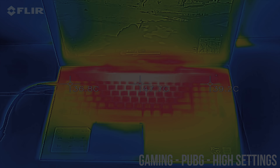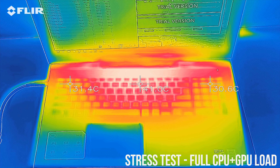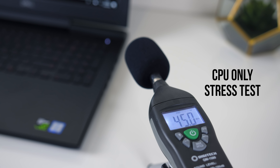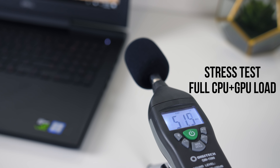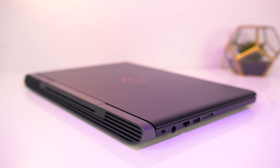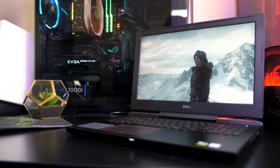While gaming the CPU clock speeds didn't change much with or without the undervolt — there was no thermal or power limit throttling taking place, so I'm not sure why the full 3.9GHz all core turbo speed wasn't the average. Under CPU-only stress tests without any GPU load, I was still seeing power limit throttling without the undervolting. I attempted GPU undervolting but saw the same performance and temperatures. At idle the body of the laptop sits in the low 30s Celsius, quite cool.